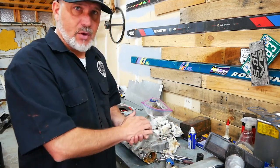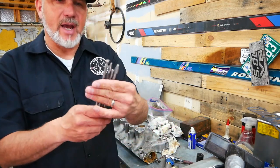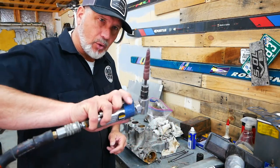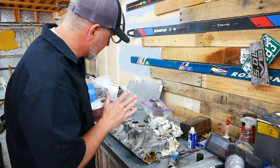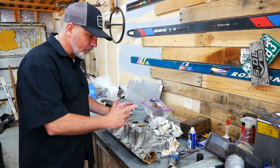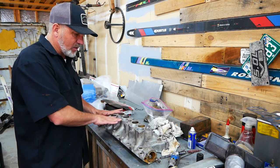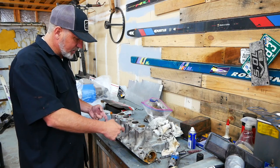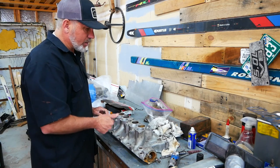So first get those dimple rasps in order to shape things, then go back through with your cross cuts and smooth out the edges, and then go with your sandpaper roll for all the detail work to get it nice and smooth. I got it down to where the last runner I did took me a little over an hour — so I went from four hours down to one hour, cutting time off each one. I don't think I cut corners; there was just less porting needed on the later runners since there's not as much of a dog leg and they were easier to get to.